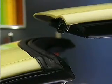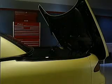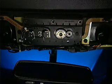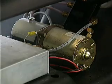The hardtop stops when it's a few inches from the windshield header — this is a safety precaution. Press the switch to the close position again to continue closing the hardtop. At this time, the tonneau will begin to close. When the header latch strikers enter the header latch, the header latch position switch tells the ECU to apply power to the header latch motor. After the header is latched, the ECU turns off the hardtop pump motor.